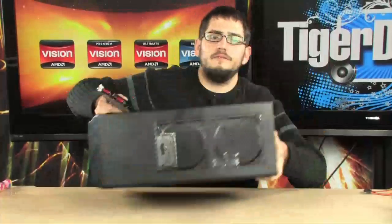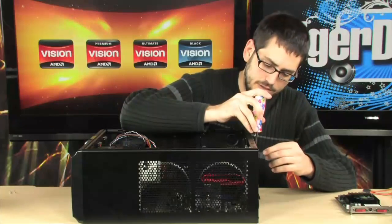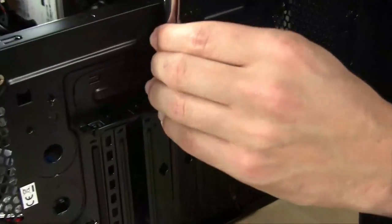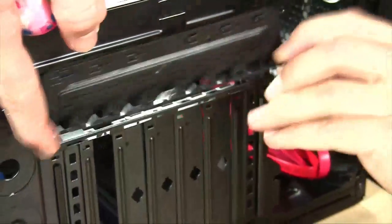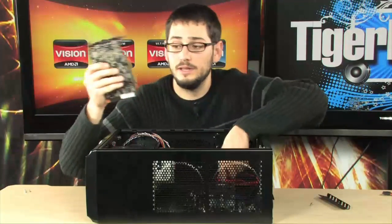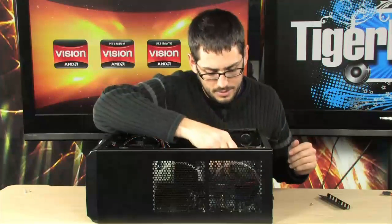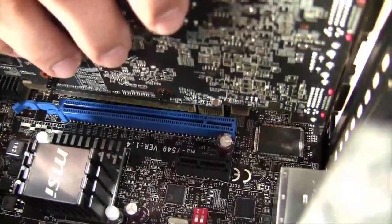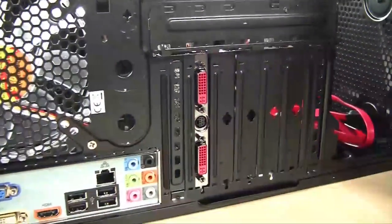Once the DVD drive is in, next step is the graphics card — very simple. You're going to need to unscrew the quick release on this side. Unscrew that one little screw, the whole thing comes up and slides off, and that lets you put in your graphics card. PCI Express 2.0 is the blue slot — it's the only one it's going to line up with. Drop it right in and it will slide in perfectly. Put the quick release back and tighten it down. We're almost home free.